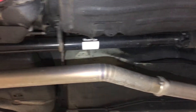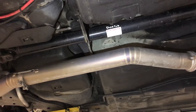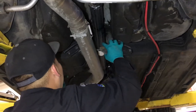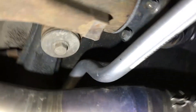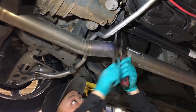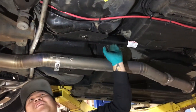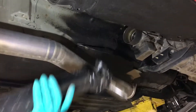The drive shaft was made at Standins, as you can see — really awesome company, affordable. I think it was 400 bucks for a steel drive shaft, custom made. We have the four 14mm nuts and bolts that hold the drive shaft to the diff. Jason is putting a pry bar in the U-joint to use it as leverage so you can wrench off the four nuts on the drive shaft. Jason has removed the four bolts and slipped it off, pulled it out of the trans.